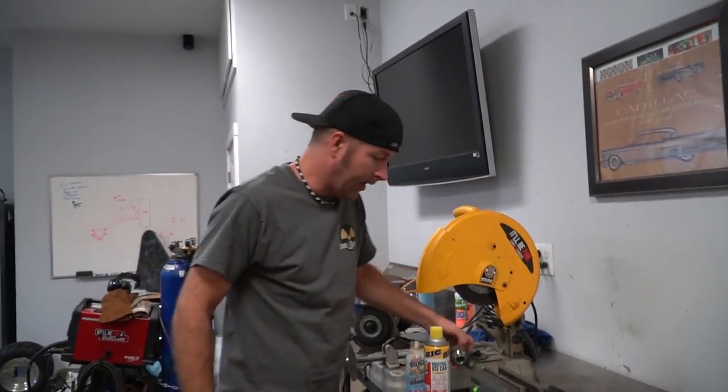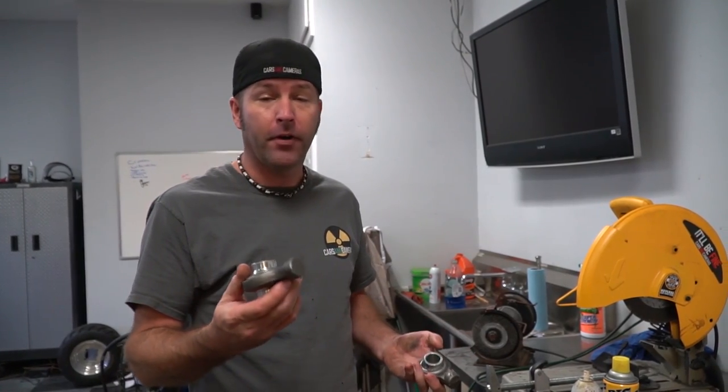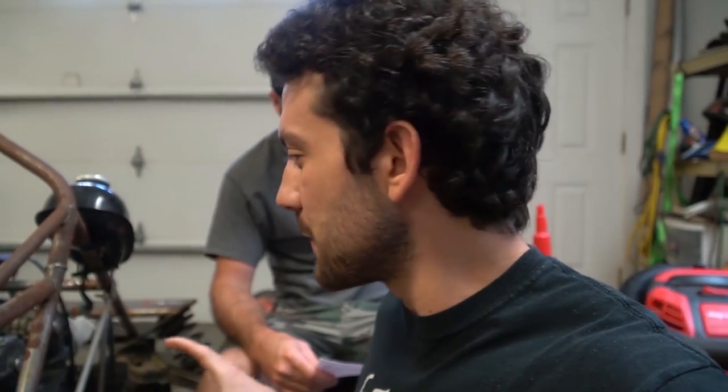So that's why we are having problems with our suspension travel binding. It's brand new joints. And the ones on our cart that we've been riding for a little over an hour are so much more free after we got some miles on it, they're working really good. If we had built the front suspension like the rear using a regular bushing, it would be a huge problem. You would be correct. But because we use these tractor joints, they're basically Heim joints. They're just labeled as tractor links. It's fine. They're able to rotate. They can actually pivot and rotate, which is what they're doing.